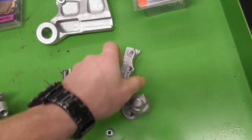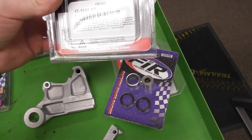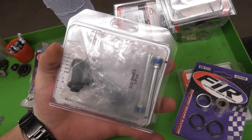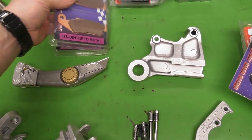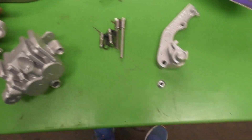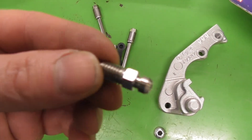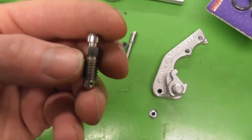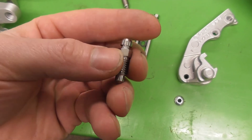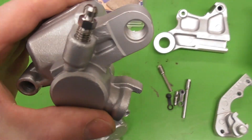The carrier - caliper carriers. And then we've got all these kits here, so these are all All Balls. We've got linkage kit, caliper rebuild kits, sprocket shaft seal kits, another caliper rebuild kit, Factory Image Racing braking pads. And they'll be ready for the calipers to go back together. We've got some Factory Image Racing titanium - some nice brake pins to go back in there and some nice titanium bleed nipples. The beauty about using titanium in alloy is the titanium won't corrode - that's what's so great about it. Just a little bit of fine copper grease and stick them back in. It just stands out and looks clean and tidy.